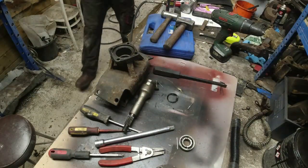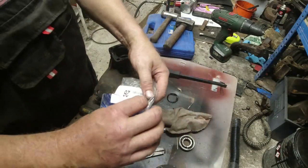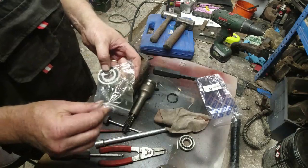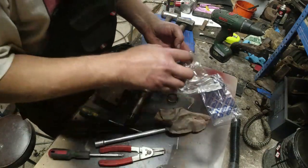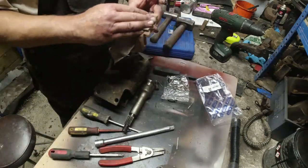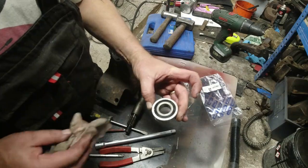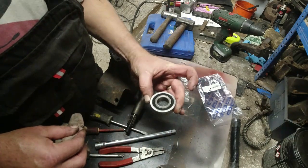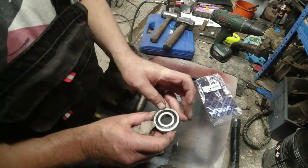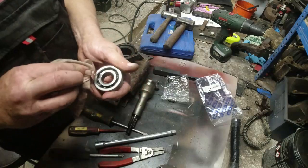Part number of this bearing is 134466. This one obviously came from Rimmer Brothers. Bearings come out the same size. Now, let me just get a little wipe over to find out if we've got any identifying marks on it. So I've got a number on here, on the one that's broken, because this lasted a lot longer than any others. PL, no, it's upside down, I think. ALS72RS. No other markings anywhere.